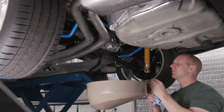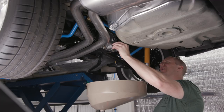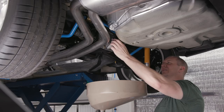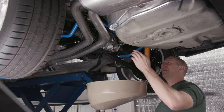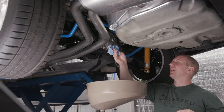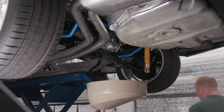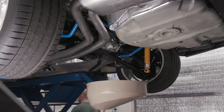Let's see if these drain bolts fit because they're a little different. I think we're okay — that's definitely good. They didn't come with a crush washer, and generally when you have an O-ring you shouldn't need a crush washer, but let's hope I don't regret it and wake up with diff fluid all over the floor.